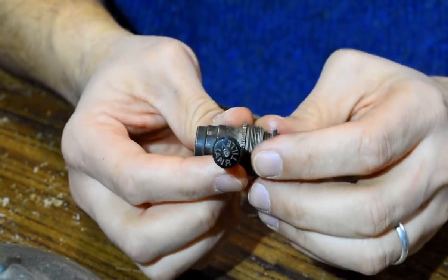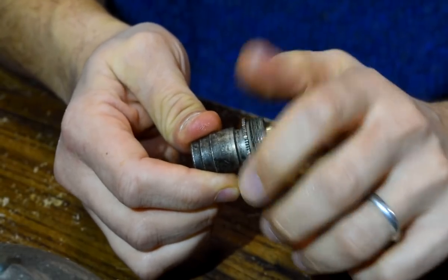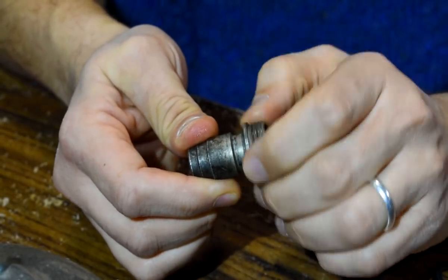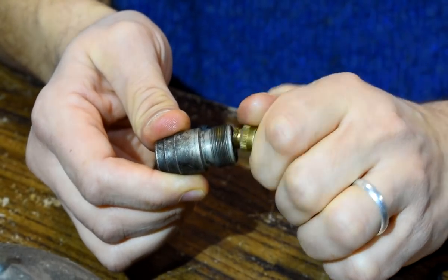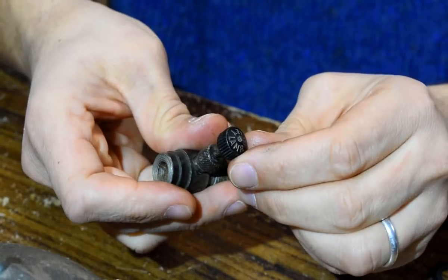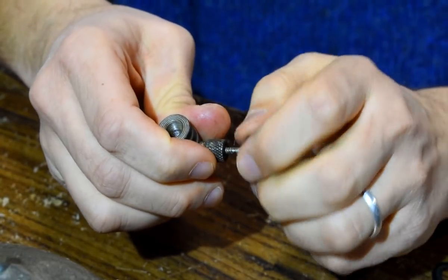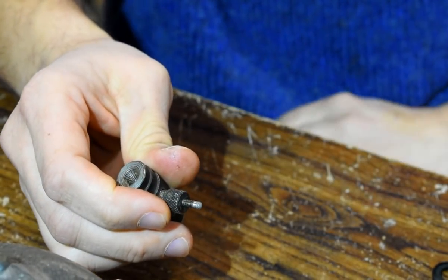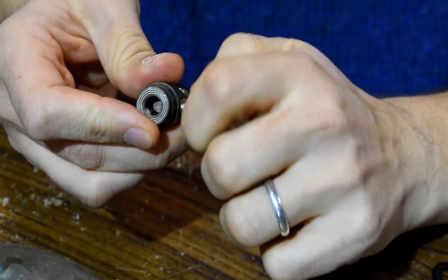Back to the valve — remove the rubber seal. This little bushing doesn't have to come off, but I'm removing it to make cleaning the valve easier. Inside the fuel strainer is another pip; this is what shuts off the flow of fuel. This is called a control cock. On this model, the plastic knob unscrews — some of the newer ones just pull off. There's an o-ring inside here that seals the shaft.